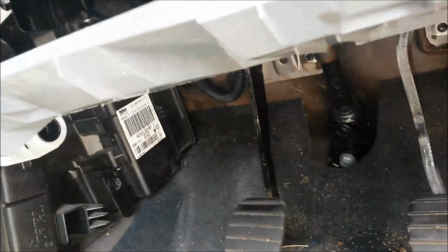Now, just throw a bit of light at it. Up there where you can see that white writing and the cabling going up there. So next thing, obviously you can't manoeuvre that out until you really get rid of the clutch. That will give you sufficient clearance to bring the fan and the motor down, as the motor back plate, as a separate item.